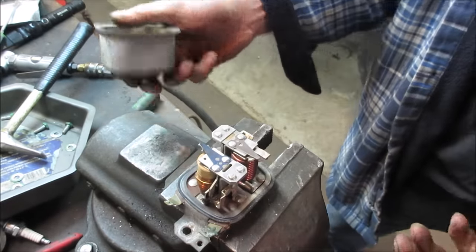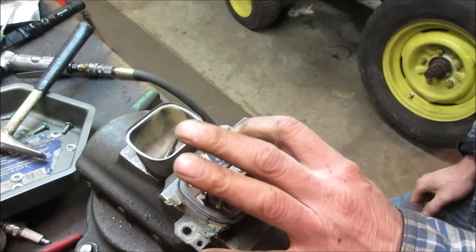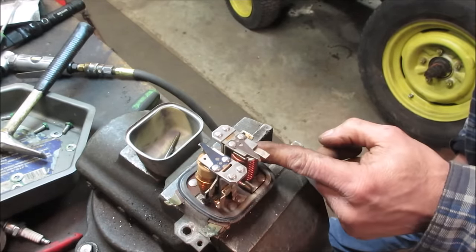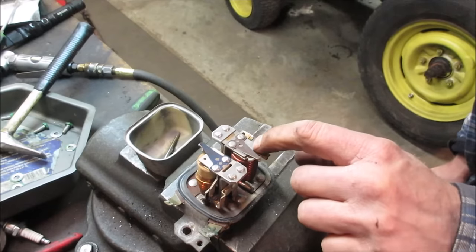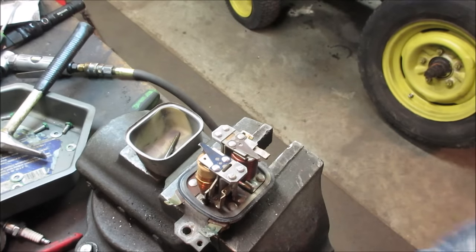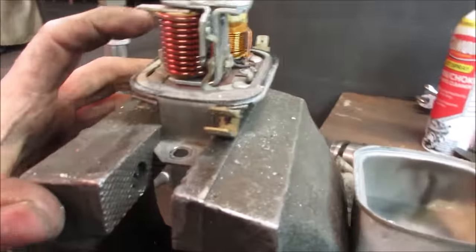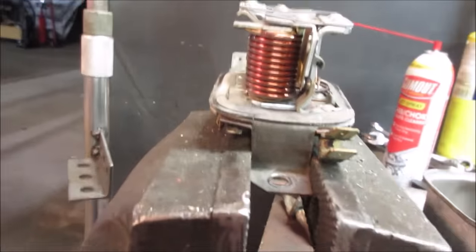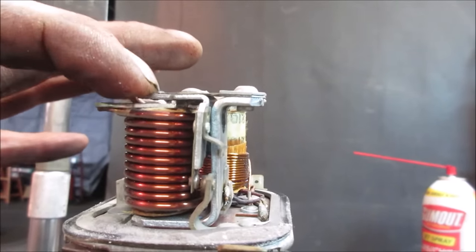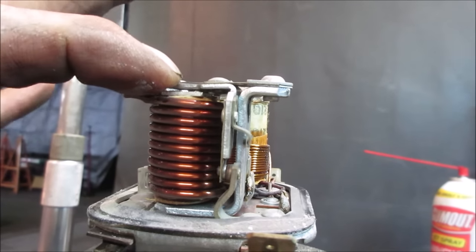There we go. Yeah. Two relays, and they have contacts on them. A little set of points. And they should flex like that. Get drawn in, turned on and off, and the same on the other side. Straightened out. Yeah, so we're looking. Magnet should energize and bring those contacts across to help the turn on and off.